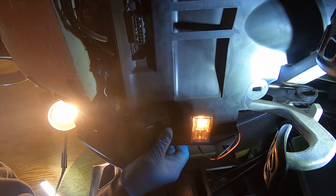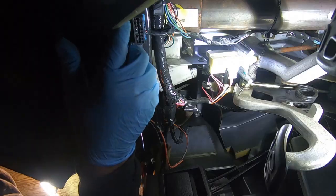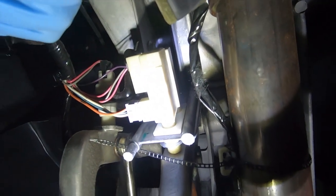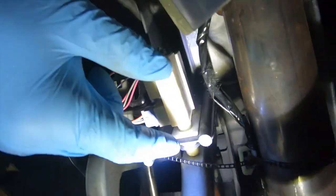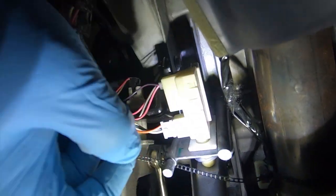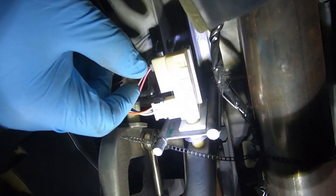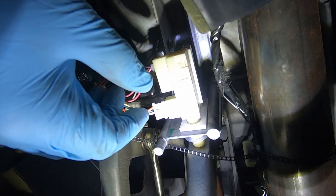Now we're going to take a look at the brake switch. There's one more panel down here held in by two push pins, and underneath that is your brake switch. This brake switch is not held in by anything other than little grooves that push through the holes. Normally if you have zero lights in the back including the center light, the brake switch is usually the culprit. If you have a center light but no brake light, the hazard switch is usually the culprit.